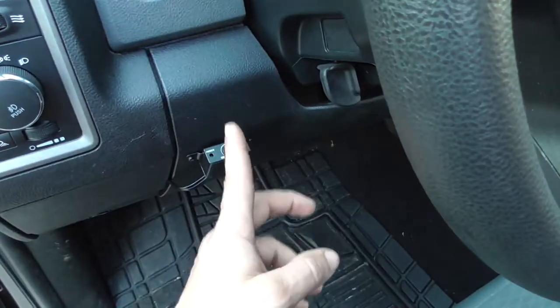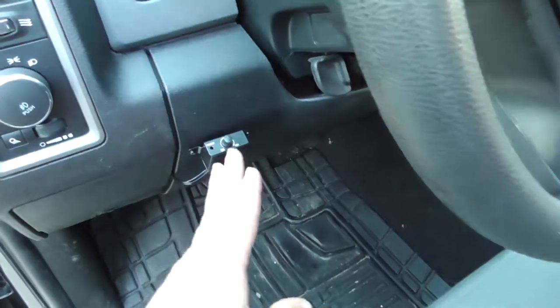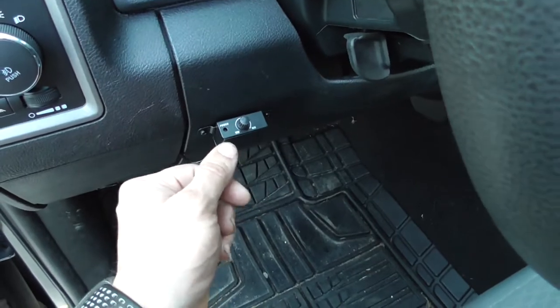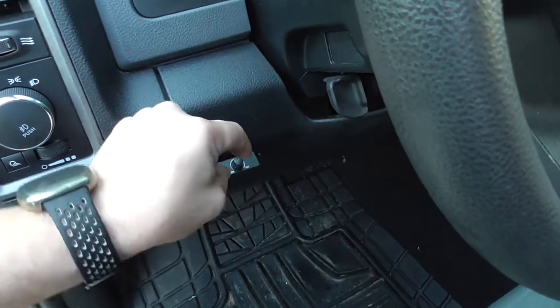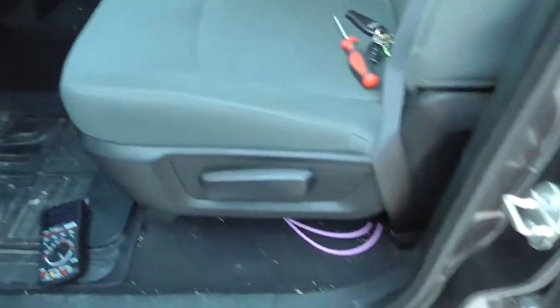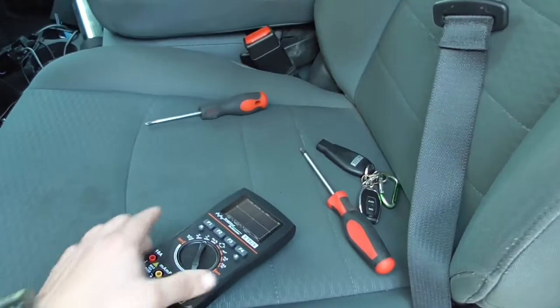When I set my gain, I put the bass knob directly in the center and then set the gain. So now, if it's turned all the way down there's little to no bass. Turn it to the middle and it's pretty loud. If there's a song with weak bass I can turn it up a little bit. That's set amazingly now. Everything's set up. I can't really play anything due to copyright, so I'll look around the YouTube library and find some random music.